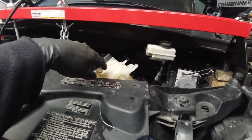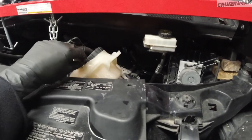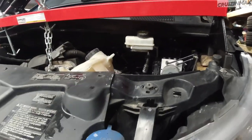You've got to remove the coolant reservoir tank. Undo the harness so you have more room to play around - just stick it somewhere so it's out of your way. And you're going to be down there, but underneath.